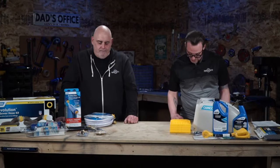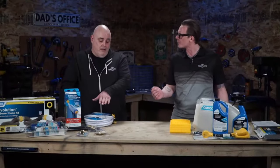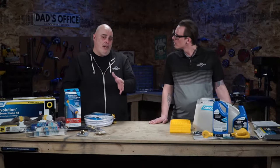All right. We got another question here from Frank asking about the PSI. What is the PSI for water pressure? So I assume, what would we need for an RV? So this is regulated down between 40 and 50 pounds, and that's exactly what you're going to need. No more, no less. If you roll into a site that has 70 pounds, and your system is that specific to needing 40 to 50 pounds, there could be damage.